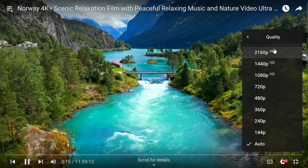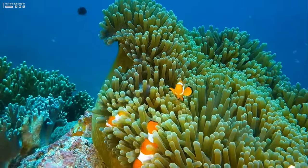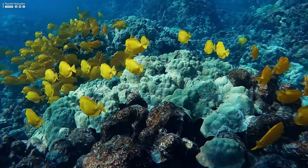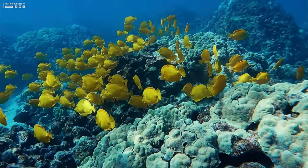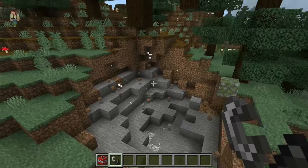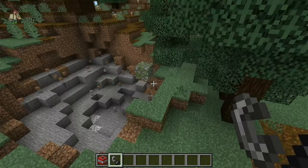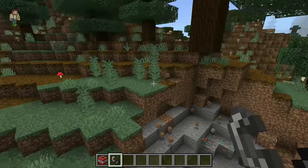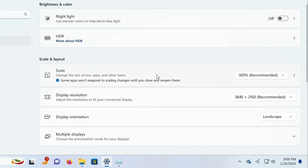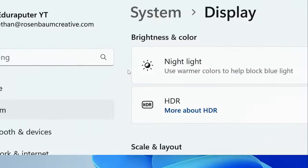Now I can watch video at 4K resolution — well, just sort of. Sometimes the video runs smoothly while other times it stutters. I know it's not the internet speed because when I tested it, it was over 400 megabits per second. Minecraft seemed a little bit smoother but there was still terrible input lag where movement would take about a whole second to respond. The dual-core i3 just simply isn't powerful enough to keep up with smooth 4K output, but all I need to do is reduce my resolution down to 1080p and it's like a whole new computer.